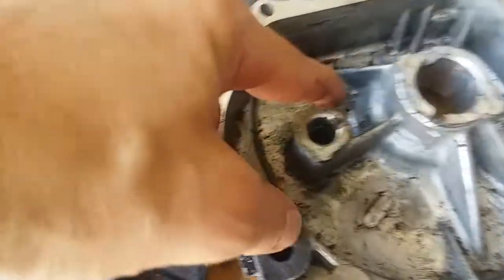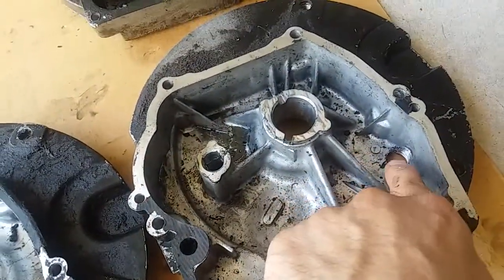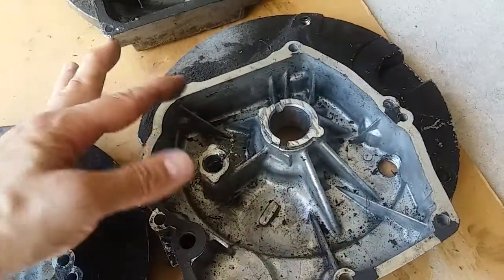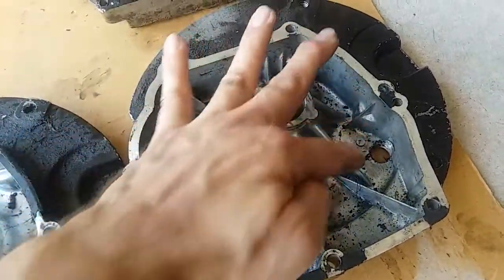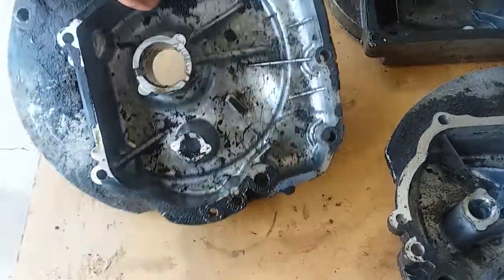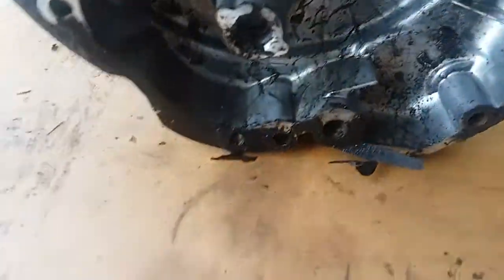Another thing is, this I call sludge. It's like pulling a cork in your bathtub, the water's just going to keep draining down. So there's not going to be a flow coming out of here to get this sludge off the surface. When you're doing the same thing here, the tube is here, the drain plug would be here, but say the tube is here, you tip this up. Now, all that oil and sludge has got to run down through the side and come out.